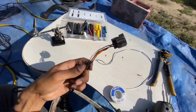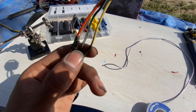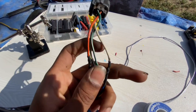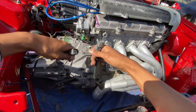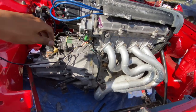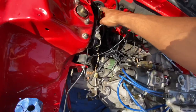We knocked out all four wires. Orange and black goes to the red because red is kind of orange. Green and white - our ground - goes to the black wire because grounds are black. Yellow went to yellow because it was available. O2 signal which is our white wire, I soldered that to the blue wire. Now we have this big long braided cable and we are going to run this through the firewall. It plugs into the O2 sensor, snaps into our bracket that we made, and then we run this wire alongside our main harness and it feeds into that AC grommet.